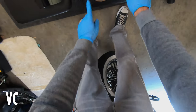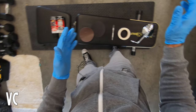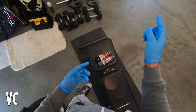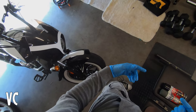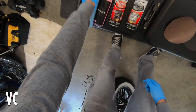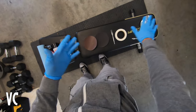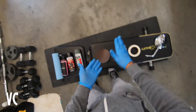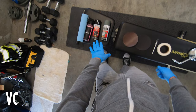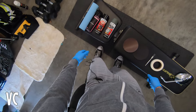What you're going to need is obviously sandpaper — we need to sand down the finish and get all the chrome off. Do that in a well-ventilated area; I'm probably going to do this outside. Also wear a mask, gloves, and safety PPE. Then you'll also need a cleaner to get off all the dust and grime after sanding, because you want a very clean surface for the primer to adhere to, so you don't get flaking and paint coming off down the line.